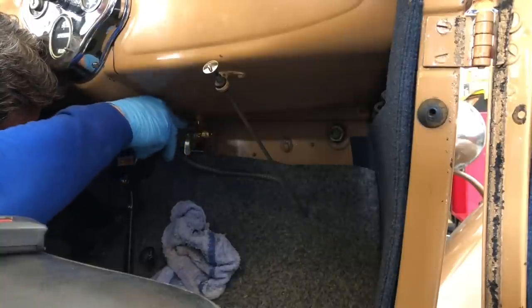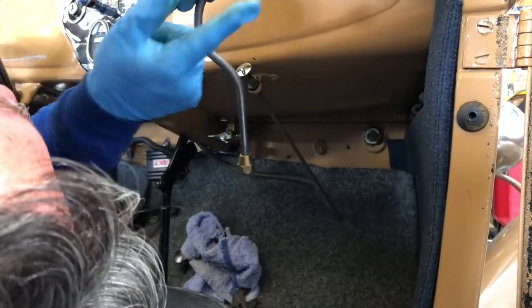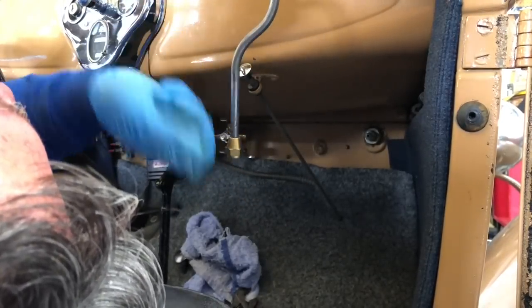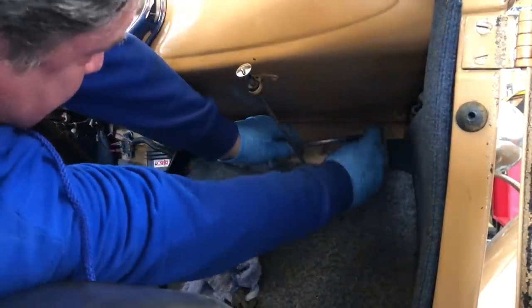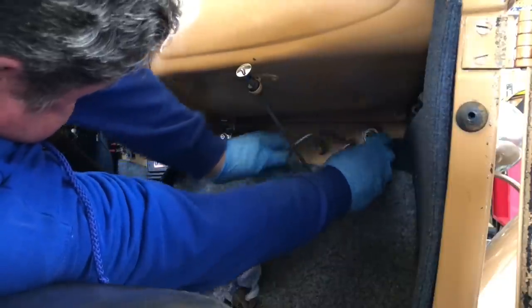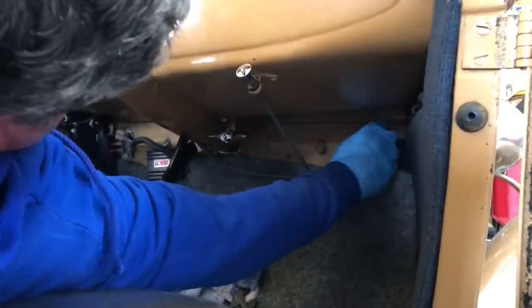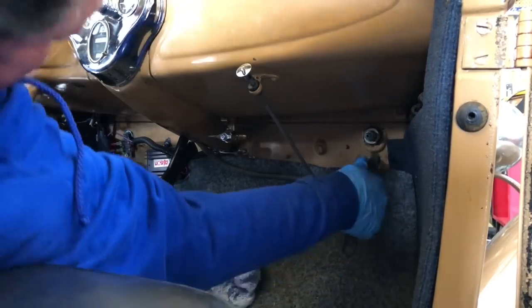This is a 1928/1929 inside fuel line. Notice it looks like a question mark. So what I do is I start by threading the firewall side of it. Actually, before we do that, we should tighten this nut because it's loose — that's very loose, and that's not supposed to be like that.